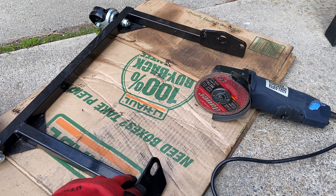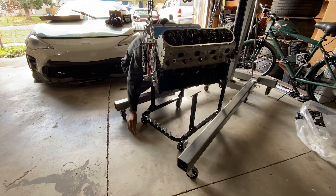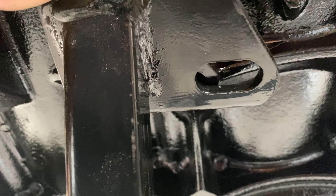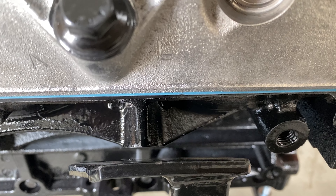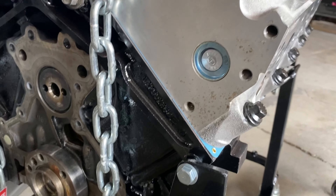Just kind of went around the side so there are no sharp edges, right outside the weld. So I'm gonna go ahead onto this piece, cut that off down here, and then throw this back on the engine. Some unexpected fitment issues — these holes need to be beveled, it's like another half inch to the front, maybe even an inch. That side along with this side — as you can see, these holes don't quite line up. So I'm gonna get the Dremel, open these holes a little bit more, and then that should be good to go.